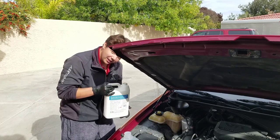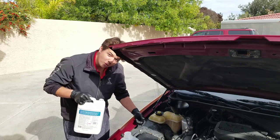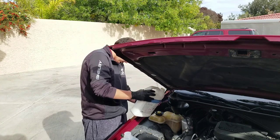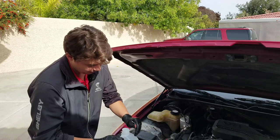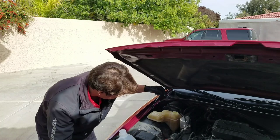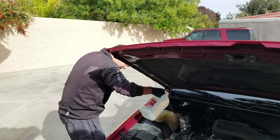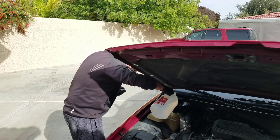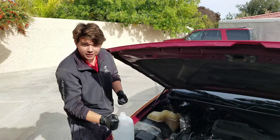So it should be five and five. I'm thinking the total fill of the system is about 14 quarts, and I'm thinking only 10 and a half quarts came out, so we're going to do about five and five. So we got our five quarts of radiator coolant in. Now we're going to go ahead and put in our distilled water. We ran it a little bit, we let the engine suck some of it in. Now we should be able to put the rest of this in. And that's it — we put the rest of this bottle in and we should be good to go.